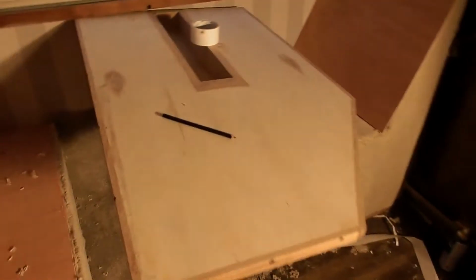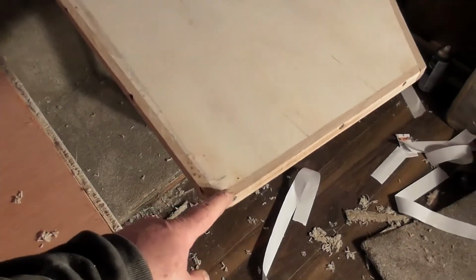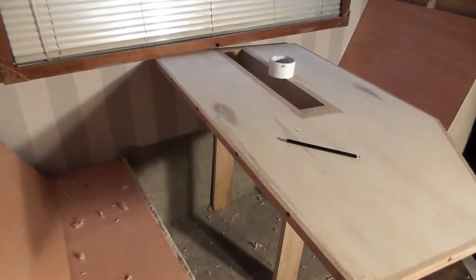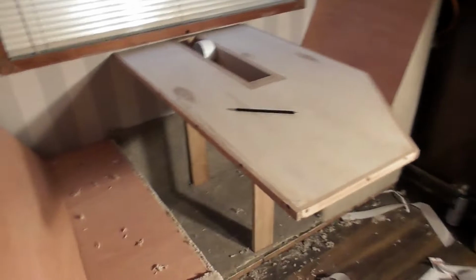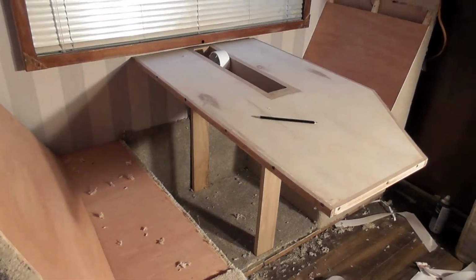This is where I've got it. I've sanded this down. Man, I have taken about 5 layers of wood, so much so that my screws, as you can see, are just starting to come through. Rubbish, absolute rubbish. That's what happens if you buy cheap plywood. Best to buy the best quality, because the veneer on top will be nice and thick and you can actually tackle that. Whereas this stuff is a nightmare.